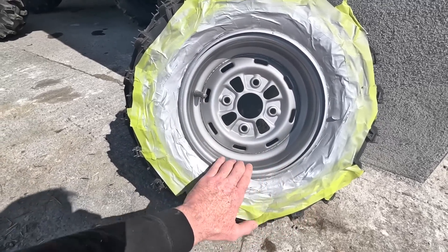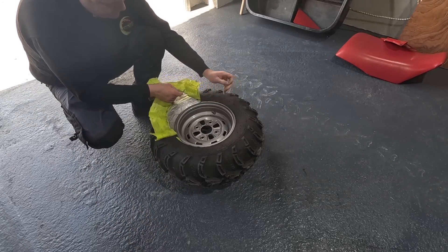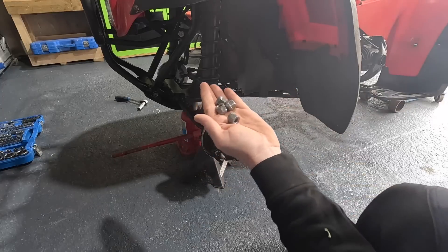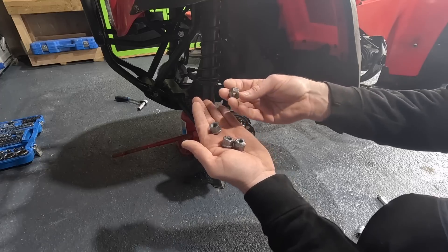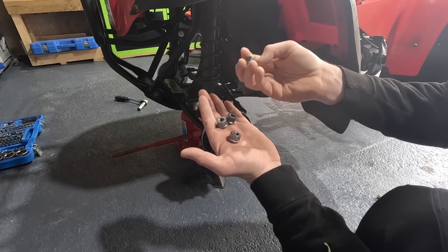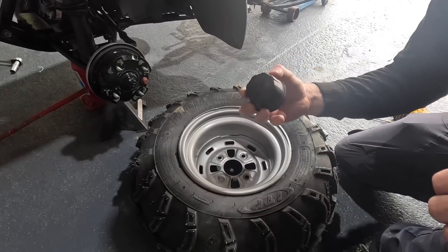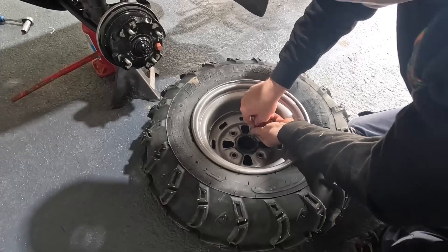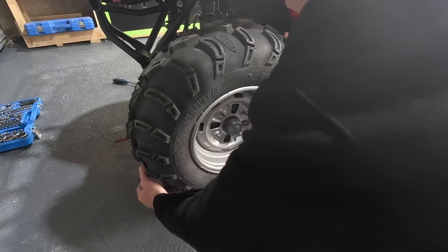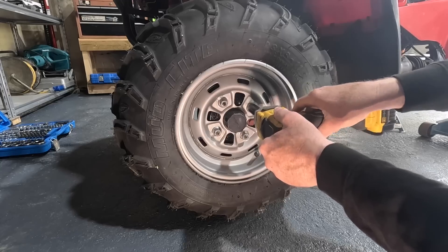No drips - I've seen some disasters with my paintwork. This was much harder to put on than it is to take off - really took a long day to get it all masked up. These are the studs - they were really rusty when I took them off. I wire-wheeled them, cleaned them up, got a nice shine on them and then just lacquered them - two coats - and that left them fairly clean looking. Next thing is to put back these Honda caps - these are original Honda caps. Just pop them back into place using a punch to push them in. These believe it or not are quite expensive to buy.